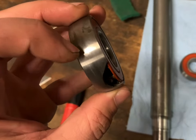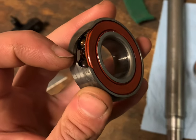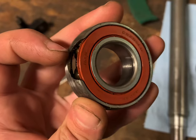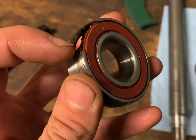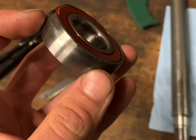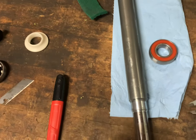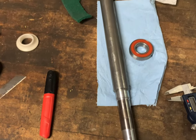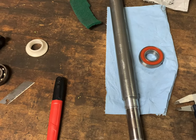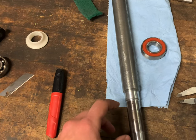You can see it's from the outer race here. This split from a chisel, but when I was trying to hammer the bearing off, it split. It looked like there was a fracture line there previously, and that looks very similar to a lot of other guys' cases. That's where it was riding in the housing — I think the housing is the big issue. The shaft, getting a new one would be a benefit, but again, it's $600, so I'm going to try and run this one.